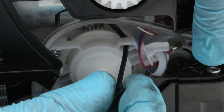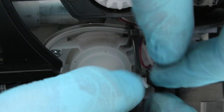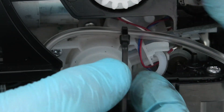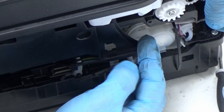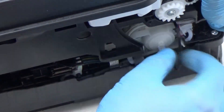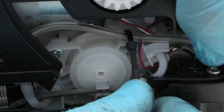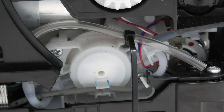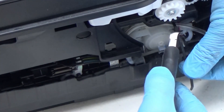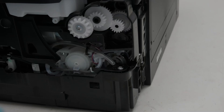So you've got it like that, and what you do is route your bit of tubing around like that and then — loosely, emphasis on the loosely — pull that so it holds that bit of tubing in position just there and routes it behind. Your piece here is going to need to be able to travel back and forth in front, so you need that tubing to be out of the way, and also this bit here. Don't crimp it — you don't want it any tighter than that. Once you've done that, use a pair of snips just to snip off the end there and rotate that back so it's out of the way.